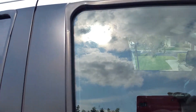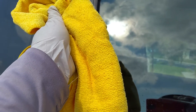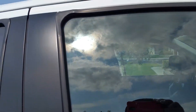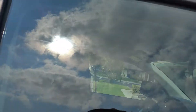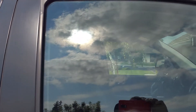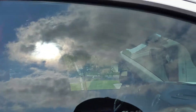The shorter nap is what you want to use for the window. Use two of them — one slightly damp, not too wet, and the other completely dry to follow off with. Use the damp one to go over and reactivate the polymer, then wipe it off with the dry one. That's how you do it, and I like to go one small section at a time.